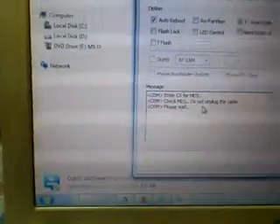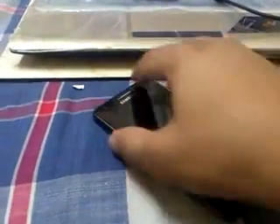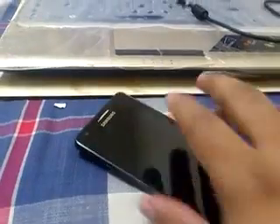Please wait — you see the file loading in Odin. Please wait. Everything is okay. Now you see the message 'Do not unplug the cable.' When your firmware is loading you will see this message. Now take your USB cable and plug in the battery again, then press home plus volume down plus power button to enter download mode.